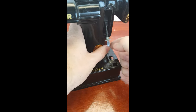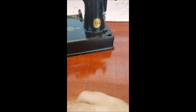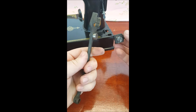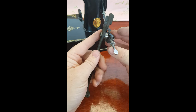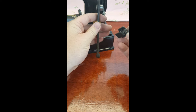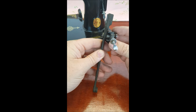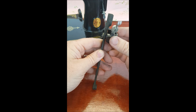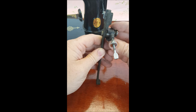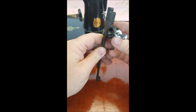I've got the parts of the lever here to show you how it works. This is the main arm that goes up and down in the machine, and when you raise and lower the lever it moves that arm up and down — that's what causes your machine to make shorter stitches, longer stitches, and all the way up it goes into reverse.